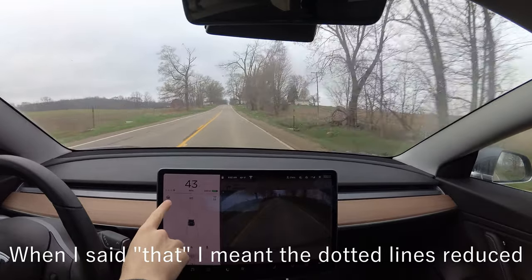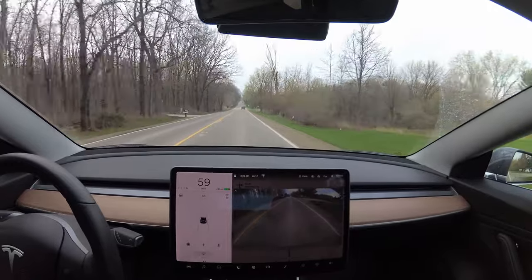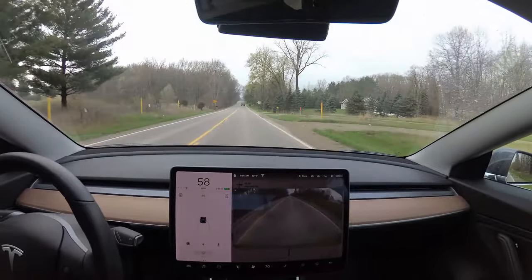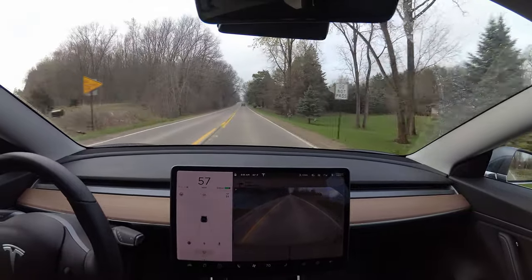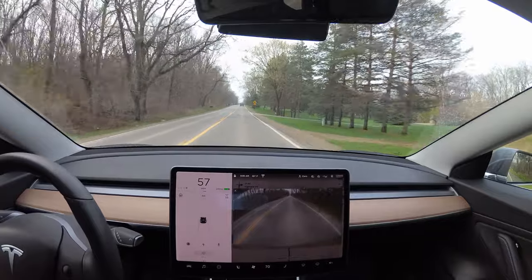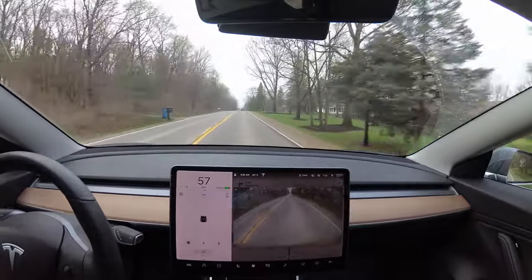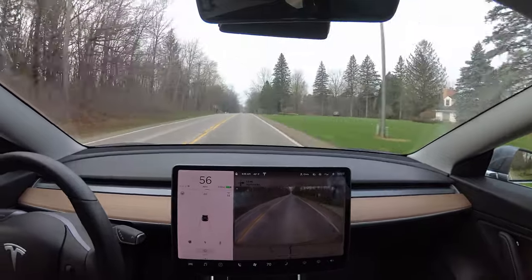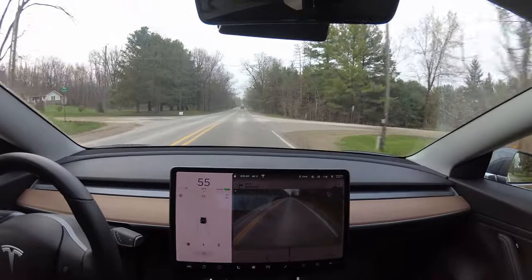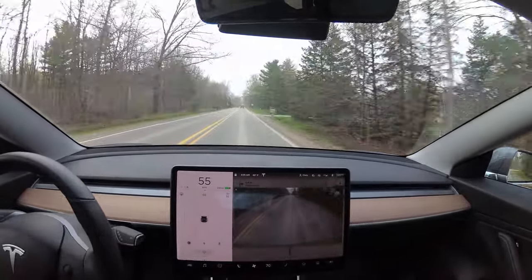If I had more regen ability here I'd be slowing even more. So even going down just a small hill like this you still regain some energy. If you were to start at the top of a mountain with 10 percent battery and you went down the mountain with your regen braking, by the time you got to the bottom you'd actually have more battery than you started with. It's a pretty unique benefit to electric cars — you can gain range on the road as long as you're going downhill.